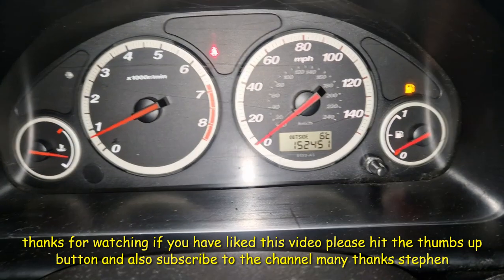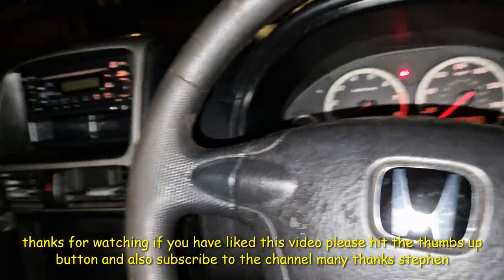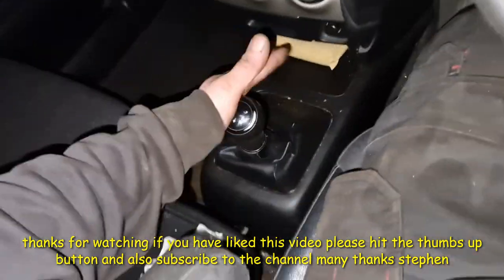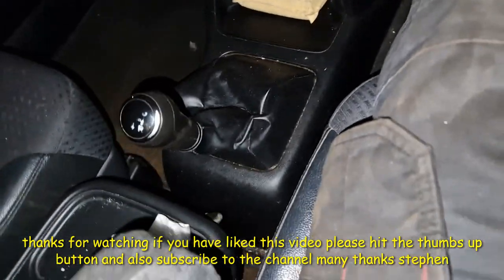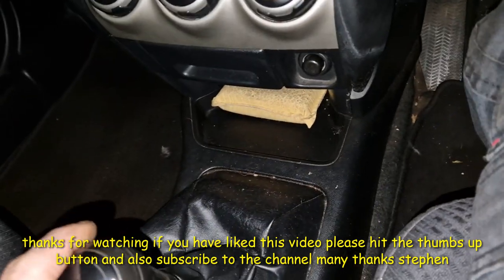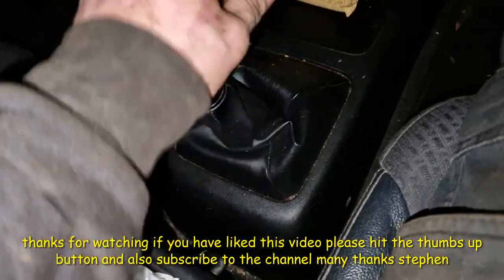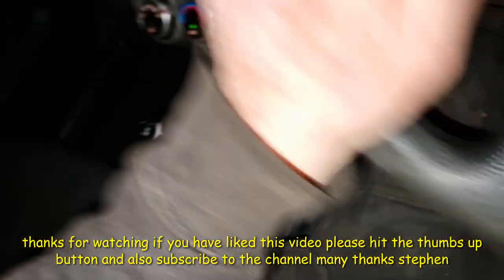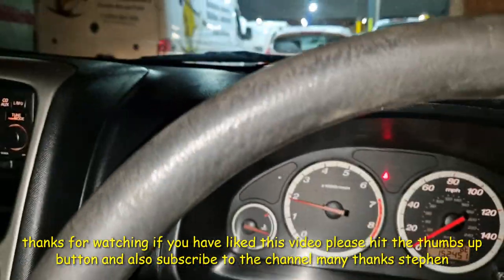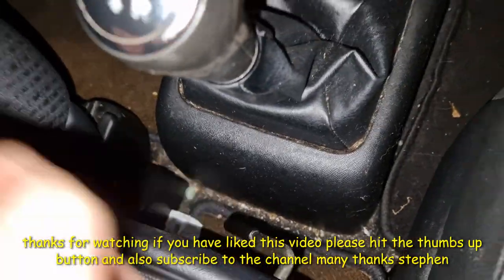So, thanks for watching this 152,000 mile Honda CRV video, guys. Unfortunately, you win some, you lose some. Absolutely every gear is okay on it. Into reverse, you see it selected it there. Don't know if you can hear it. You hold the gear stick forward and it goes away. Every other gear's absolutely fine, or seems to be anyway. I doubt that's anything to do with oil or anything like that. Anyway, park it up. Yeah, it's just reverse.